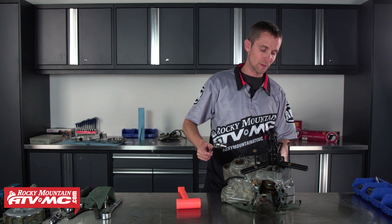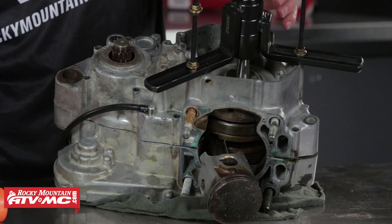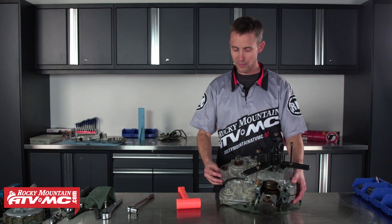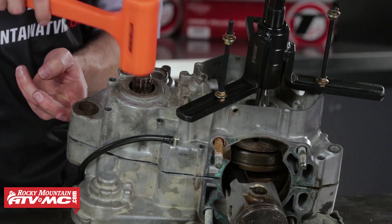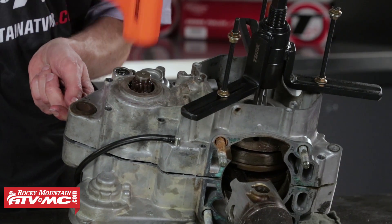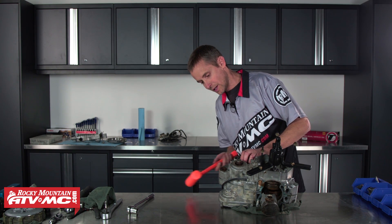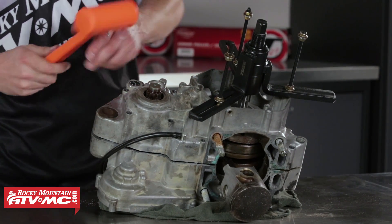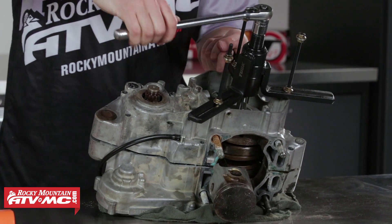As you can see, the cases are starting to split apart, but you'll notice it's splitting apart more in the front than the back — so something's hanging up in the back. We want this to come apart as evenly as possible, so we don't want to go too far without that back coming out. Something you can do — again with a rubber mallet or dead blow — is hit on the countershaft. Sometimes you actually have to take the dead blow and hit that little tab. There's a dowel where your swingarm bolt goes in that kind of holds the case together sometimes. The goal is to get the cases to come apart evenly.